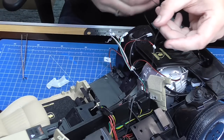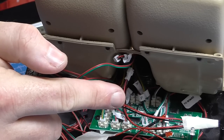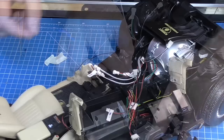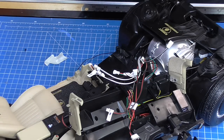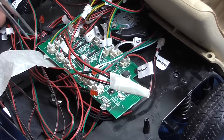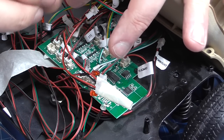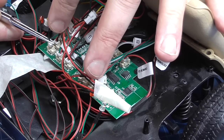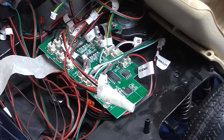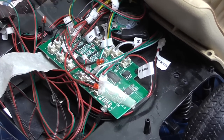I've just plugged in the black lead that comes in this pack, and I'm going to route that with the other leads underneath the car so it comes out the back. I already had power from the mod I put in, so I'm going to plug that into the socket just next to it. Then it's just a case of putting everything back together. The final thing to do is take out this green and yellow cable and replace it with the black cable we just plugged into the main unit. The green and yellow cable is then going to go into where cable H is, because we don't have those lights anymore. And there we go - that's all in.